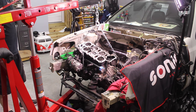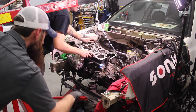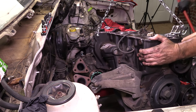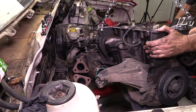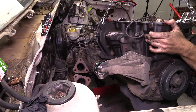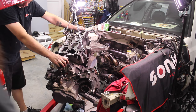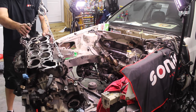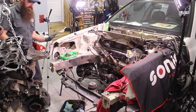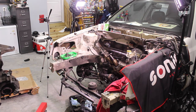There we go — we are free. Watch the slave cylinder. Watch the brake line. Luckily, that's mostly water at this point. A couple years ago I built this really cool rolling bench for our freezer, and that is exactly where we're going to put this. We got the engine hanging and I'm going to ease it down onto this rolling platform. This is where we're going to be separating the engine and transmission, and then the block is actually going to go up on the engine stand.